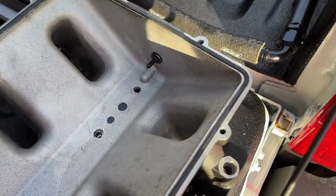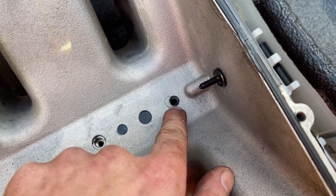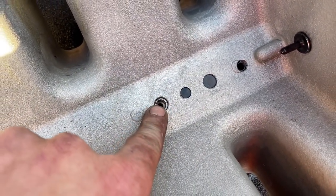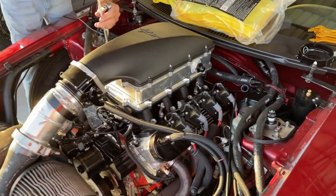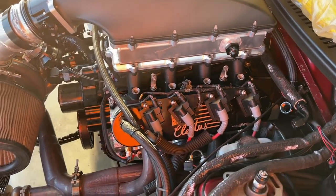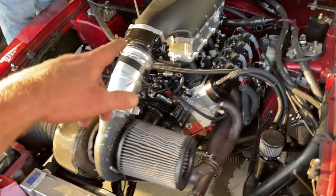Here's a good view with my sensor back in. Manifold air temperature is going to be here, MAP sensor is going to be here, and then the line going to the blow-off valve is going to be here. These two ports are plugged. Now that we got the sensors back in the intake, Sam and I are bolting this thing back down. I'm going to send the injectors off to be cleaned since it seems like a few of them are stuck.